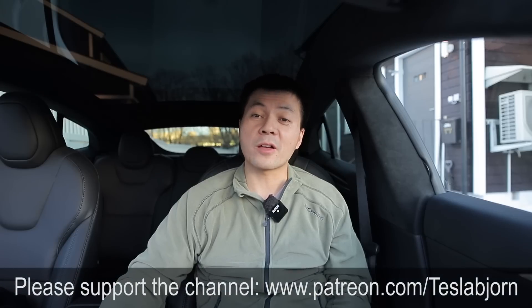Now you guys have seen it - Tesla Model S. This new Model S with new battery tech - we are still using the 18650 cells, the somewhat outdated form factor, but Tesla has redesigned pretty much everything. There's different chemistry in each cell, and they've redesigned the whole cooling system. That's why the new car here can charge way faster than the old one. If you look at the previous generation Raven, outside it could almost look the same - you can kind of see it in the front section - but the battery is completely different, a way better generation. I hope you guys enjoyed this video. Thank you for watching and talk to you later.